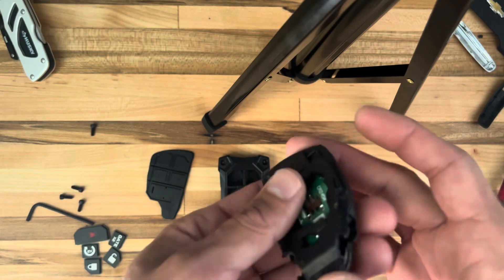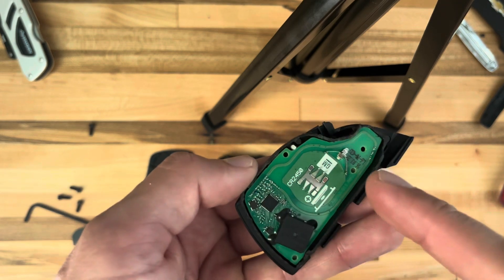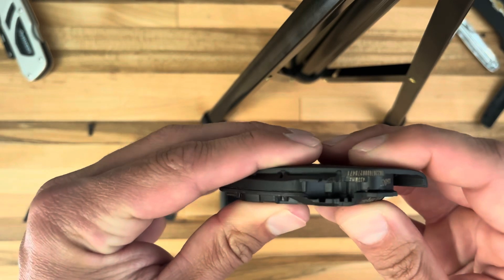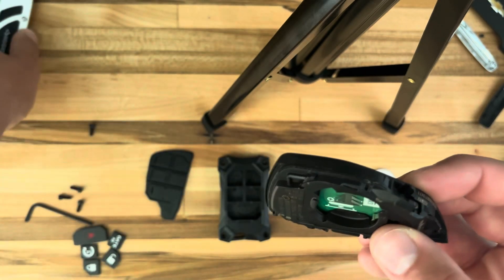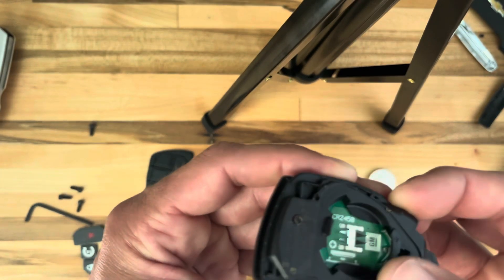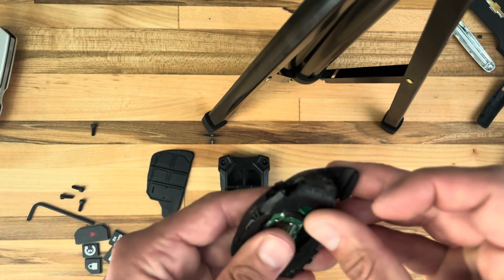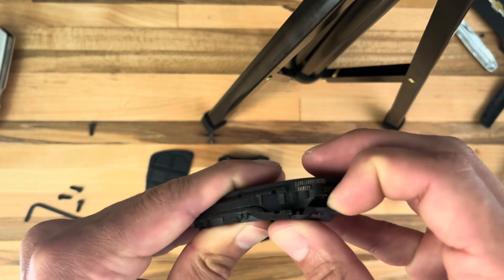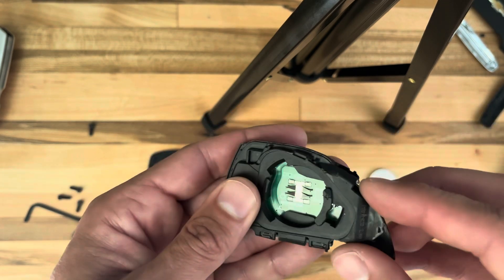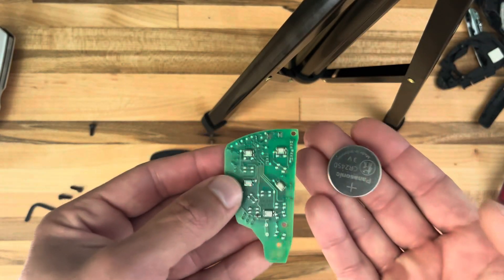Now this is the more tricky part. This case has already been apart, so this piece comes off. However, as you can see along this perimeter, this piece is glued. So when you take yours apart for the first time, all of this is going to be glued all along here. You're going to need to take a utility knife and cut around there, and when you do that you have to be very, very careful that you don't damage this board here — because if you do, it's kind of game over. What I found works best is to cut under here and simply use a screwdriver to pry it apart. Once you get it started, it will just kind of come apart. You can cut a little bit to help yourself, but you can just pull it apart and it will separate on the glued joint.